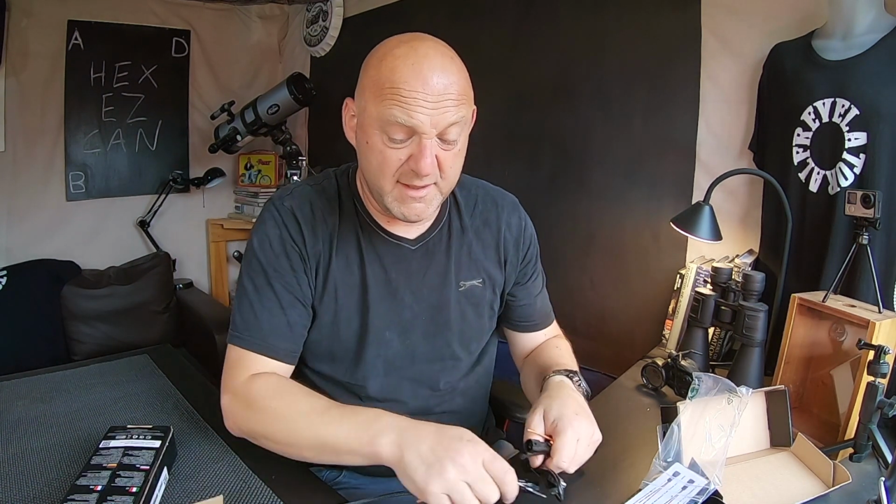The beauty of this, as I say, is once you've got it all powered up, then you just go into the computer here and you decide what you want to fit onto it. So basically it's got 4 power circuits. You can change the fuse rating. You can power any accessory to any fuse circuit. It doesn't really make a difference. You can dictate what it wants. So if you want auxiliary lights, if you want extra rear lighting, if you want powered accessories, let's say for phones or for sat navs, that kind of thing, or if you want to wear heated gloves or heated garments, let's say for the winter, you could power all of that from this, and you could set the fuse ratings and it works really well.